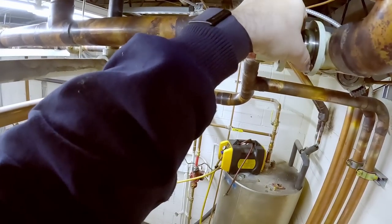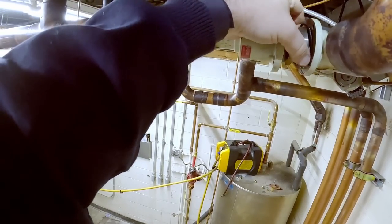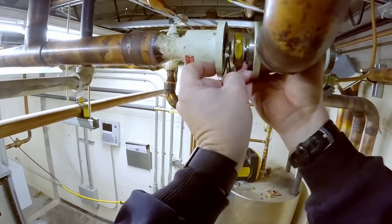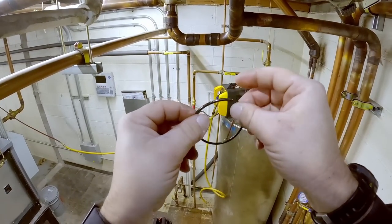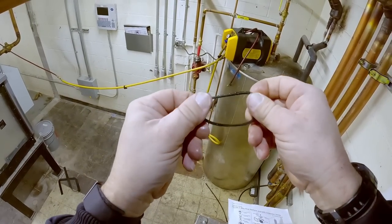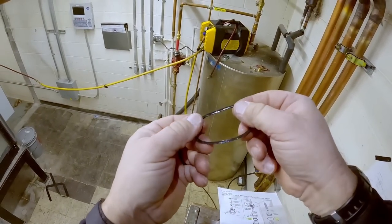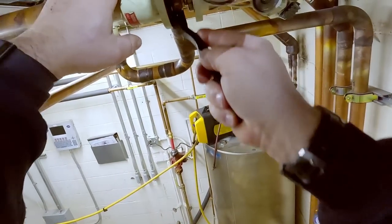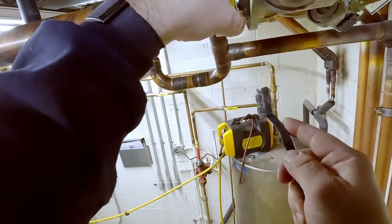There's the end of it that goes up in there. There's that O-ring we need to replace. That piece looks like it holds right there. And right there — that's why it was leaking. It's tight, it does not want to stretch at all. It's also flat. Let's make sure our surface doesn't have any gunk on it.